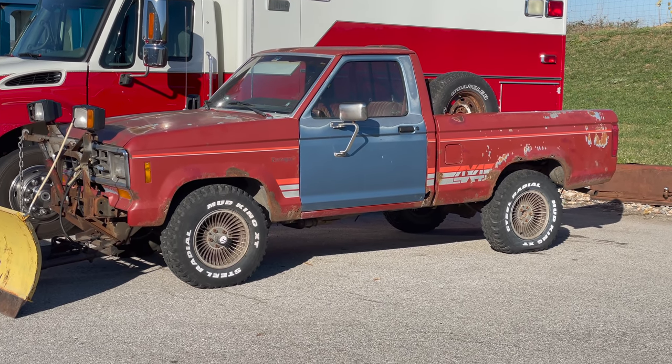That will stay liquid inside and will always be protecting the tire. If I develop a new leak or a nail goes through it, this stuff is still going to be in there and will repair that leak. They also send special valve caps so you remember which tires you've put the Tire Jacked into. On this truck I have an open differential in the back, so I can put it in drive and let the wheel rotate to distribute the Tire Jacked all over the tire without the truck moving. I have the snow plow on the ground to prevent the truck from going anywhere. I'll just let this run for a few minutes.